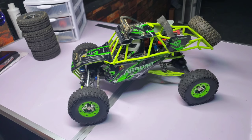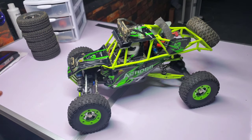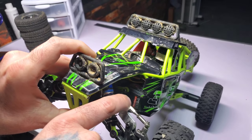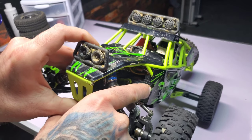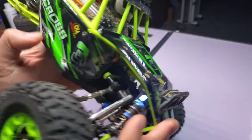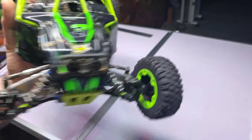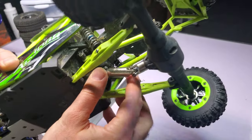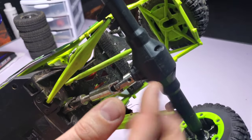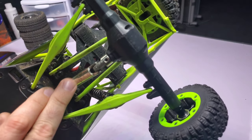Where do I even get started on this thing? This is one of the most highly modified vehicles there is. I have a brushed motor from a Redcat Volcano in here. The servo — you can see it right in here — and there is the receiver. I'm not taking this lid off, sorry. The ESC with a fan — stuff is really jammed in here. One thing I've done is the drive shaft. A lot of people have trouble with this drive shaft, and I found one that works phenomenally. It's just a CVD all the way around; there's no pin to fly out.